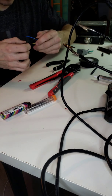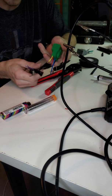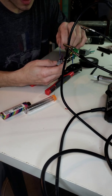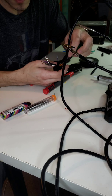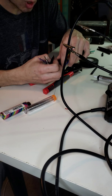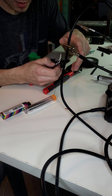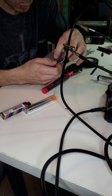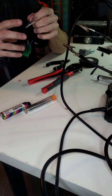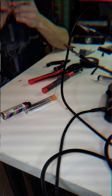All right. So then you got those done. And again, I think it does have a blue wire that's missing on the radio part. But again, it's just as simple as matching the same color to the right color. Almost all radios are pretty color coordinated. You know, green to green, blue to blue, red to red, black to black, purple to purple, gray to gray. And then next I'm going to get into explaining the speaker wires and how those are connected. So stay tuned.